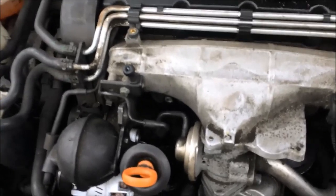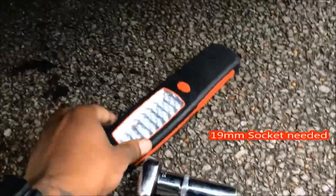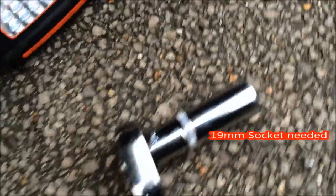The next time you'll be looking in the engine is just when you're topping up the oil. Get under the car and find out where exactly the sump plug is. On mine it was a 19mm. I've got my little torch under there and my 19mm socket and ratchet — I'm going to loosen it off with the ratchet, and then loosen it by hand. Once you've cracked the bolt and loosened it off a bit, then you can do it by hand. Get your bowl ready.